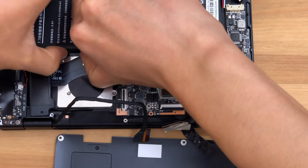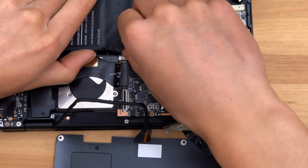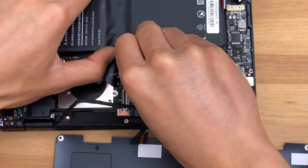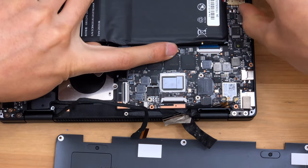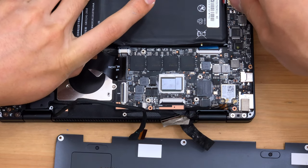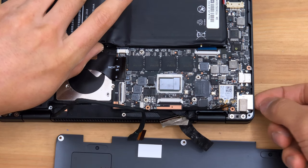The battery is not glued very strongly into the casing. With that said, there are flex cables underneath it stuck in the glue, so we do need to be very careful with the battery and the area. That might give us the small amount of flexibility we need to take that board out. Likely the USB-A connector is what's stopping us.